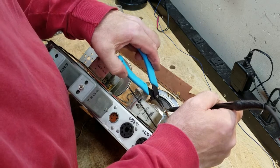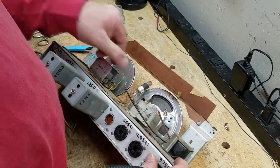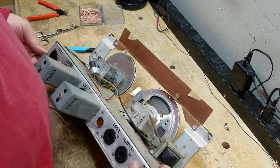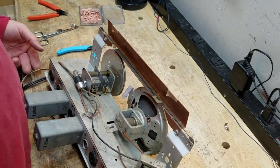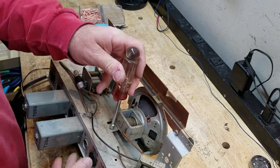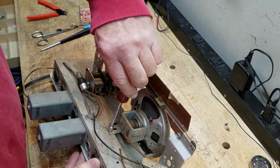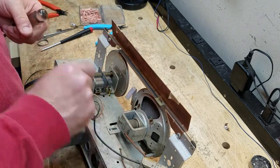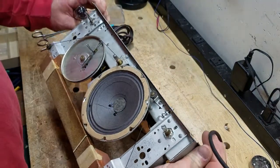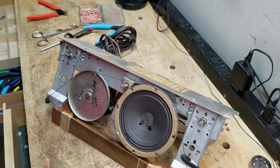I don't know if this is factory — you don't see factories wrapping terminals too often like this — so I'll bet this has been off before. All right, speaker is disconnected electrically. Let's go ahead and pull that lamp off of the little holder that's on the speaker mount. It looks like there are three screws that hold this speaker in place. One of these screws is a quarter-inch screw. It's a little permanent magnet speaker, which is nice, because if there's anything wrong with it, it's easy and inexpensive to replace.